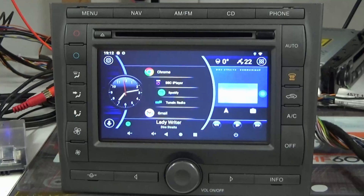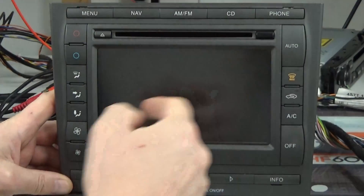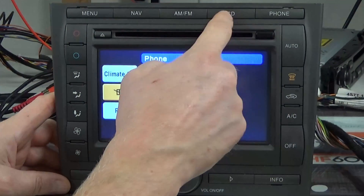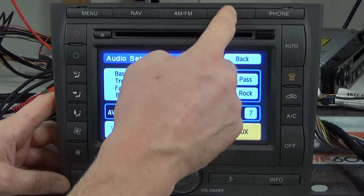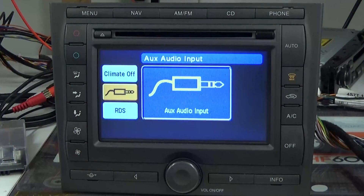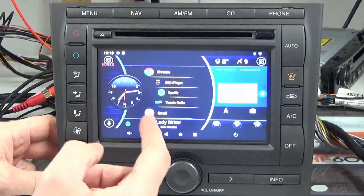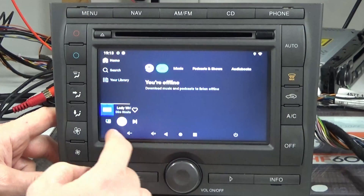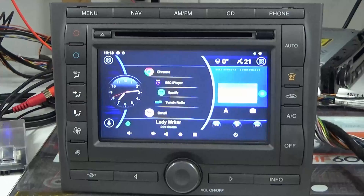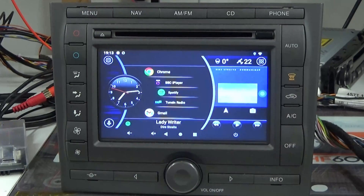When playing music, it will be connected to the aux input of the car. On the Ford system, you go into CD mode and then activate aux input via the menu, so when you press CD it's taking audio from a 3.5mm jack input. That's how audio from the Odroid computer comes into what I call the Fordroid. If I go into Spotify and play music, you can hear it come out of the speakers — I'll stop that so YouTube doesn't give me a copyright strike, but you get the idea. Car Launcher Pro will show cover art and you can skip tracks forward and back.